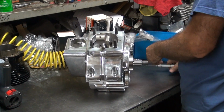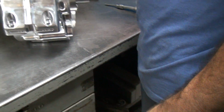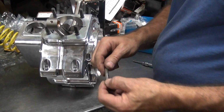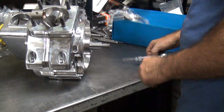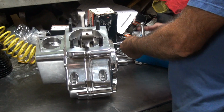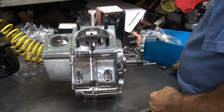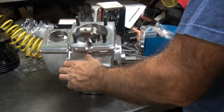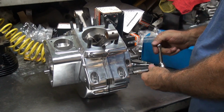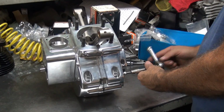Your stainless steel screw, see how it's galling up the first thread when I was trying to screw it in by hand? Why? I don't know. This one's going in now, but the first time it was galling up. That's because there's nothing on this thread to keep it from galling. There's no lubrication. Dry stainless and aluminum like to stick to each other. They're not very compatible. Are you using Loctite or assembly lube on those threads? I don't know. Hear it squeaking? If it stopped all of a sudden, we're done. That means the threads are all screwed up. You said you had all the grit out of the hole. Yeah. I just shoved it in there. Figured you knew what you were doing.